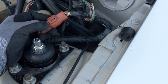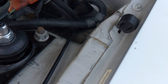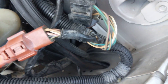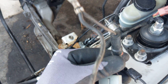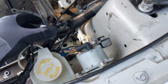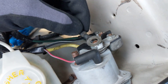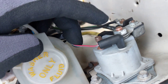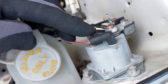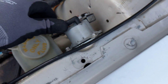This is the only piece you're going to separate here. That comes off, and then all this is V8. This here from the V8 obviously connects to it. This is for the ignition coil, this is for the ground, and this one's going to go to the battery. This goes to the starter solenoid — it's going to go here, then you're going to run the power from here to the starter, and then the solenoid to here. Now this is a 93 so the starter solenoid is separate. On the 87 to I believe 91s it'll be on the opposite side, but you'll be able to figure that out.